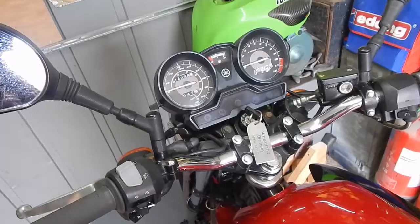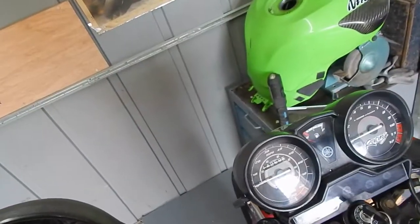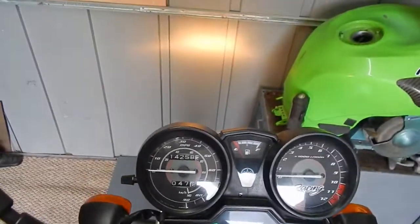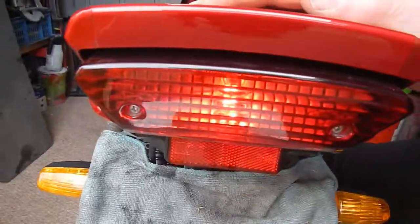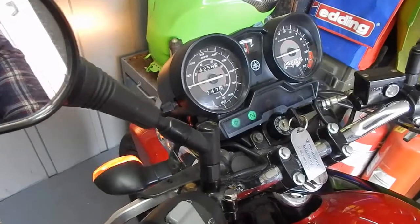Moving on to L for Lights. Lights can be checked using the back wall of your shed, garage, or any building wall. Turn your ignition on — this bike has daytime running lights, so you can check dip beam and main beam, and verify the telltale light also comes on. Moving to the back of the bike, check the tail light, and by reaching across with your foot you can check the rear brake light, checking the front brake light via the reflection. Indicators are easy to check — flick your switch, look for the telltale, check the front and the rear on both sides.